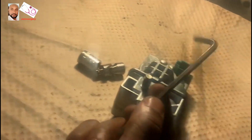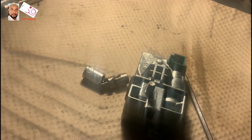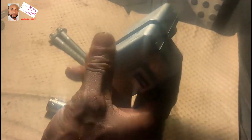The plug connects right here. The best thing is when you press this tab — that's the one here as you guys can see. I have to use that tool to push it down, and once it's pushed down and I hold it, I take out two of the steering column screws — the two in the front and the two in the back. I just loosened them, I didn't take them out completely. I only fully removed the two in the back. That's how you get it out.